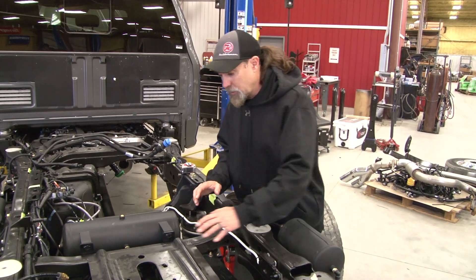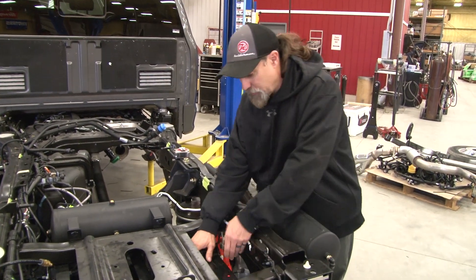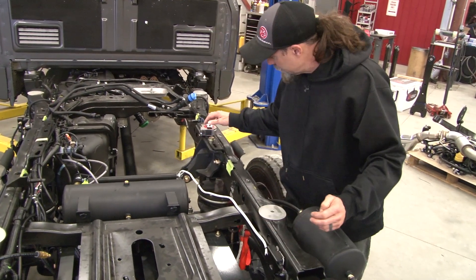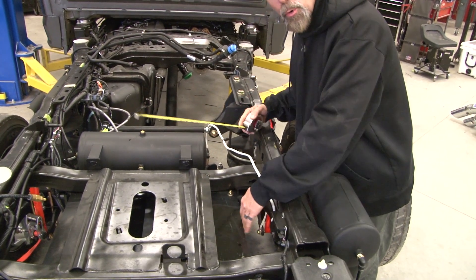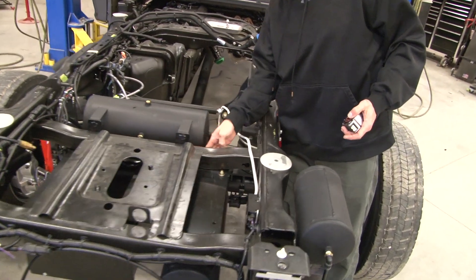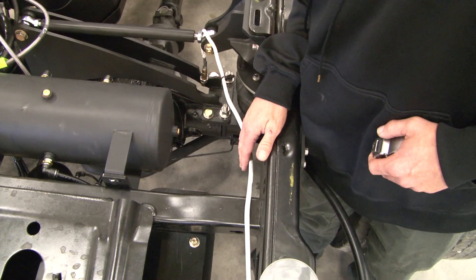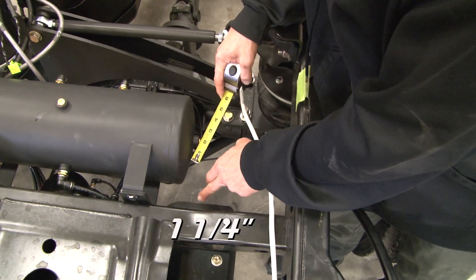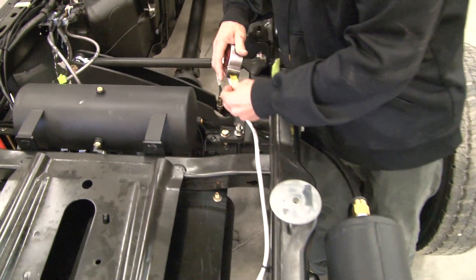Right now we've got our box mounted and our front air tank mounted. Now we're going to mount our second air tank. Your kit is going to come with a mounting bracket that gets welded to the bottom of these cross members. If you measure over from the passenger side frame rail four inches, that's going to be to the edge. This bracket is curved on the front side — we have it mounted straight with the curve going toward the front. We're bringing it inch and a quarter from the edge of the front, and four inches over. That's where you're going to mount this tank bracket.